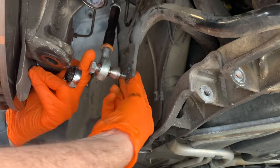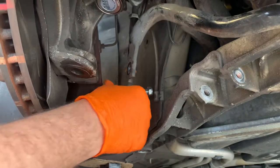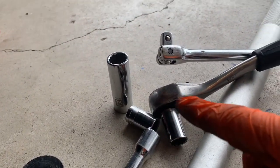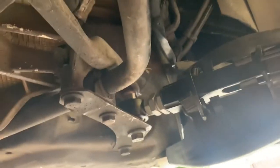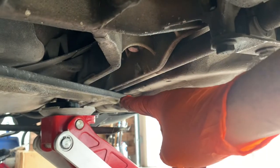Put the nut back on, so I don't want to lose any of this kind of spacer things. Okay, that side is okay. To undo a few bolts here to loosen them off, we need a 15, a 16, and an 18. And I had to use a pipe and a breaker bar to undo some of them because they're pretty tight. And here is what we're loosening off. So we've got a brace here. Right, so that's a 16, that's got to be taken out completely